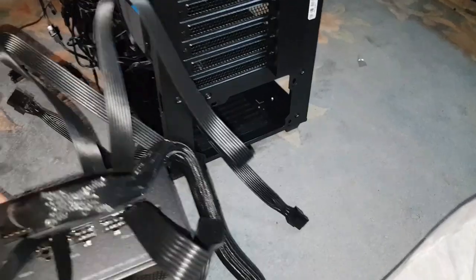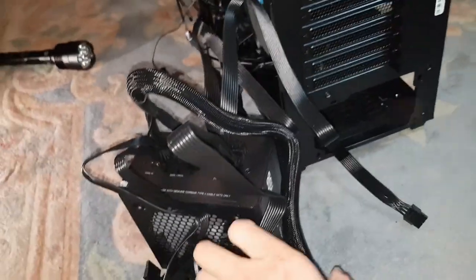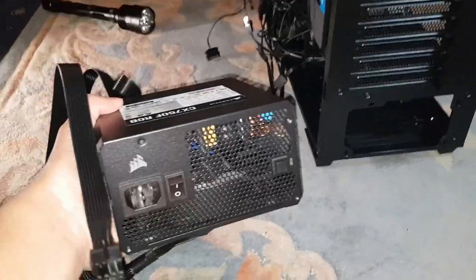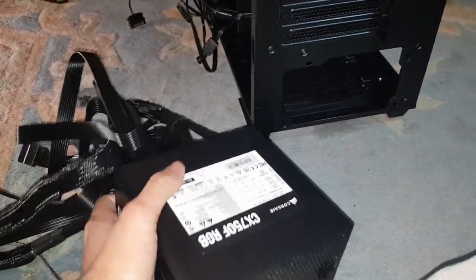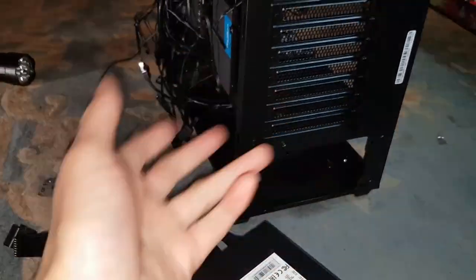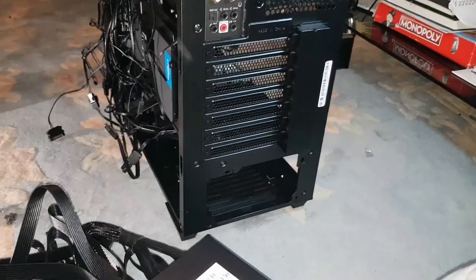This side's going to be on the inside, so we need to turn it around. I'm just going to double-check everything's plugged in that I want plugged in. One PCIe should be fine — no need for a second unless you have a powerful graphics card. So we want the fan facing downwards where the ARGB fan is. If you have it facing upwards it becomes an exhaust fan, pushing hot air through the case instead, which is not ideal.